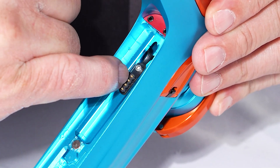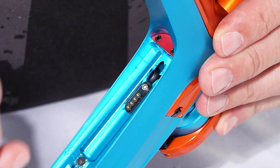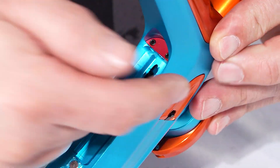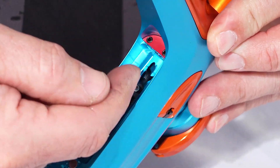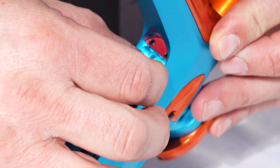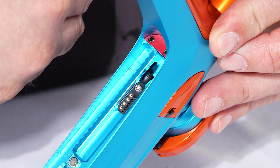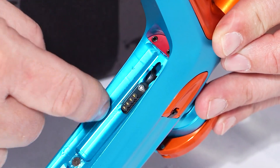This ribbon comes right out on both sides — and that is your actual both eyes. Once you have both eye covers off, you can unlatch it and pull the ribbon out. When you have to replace it, just slide the ribbons back in — one goes one way, one goes the other way — and screw it back down.